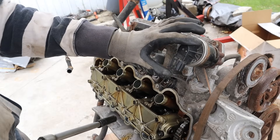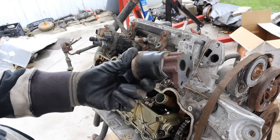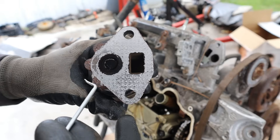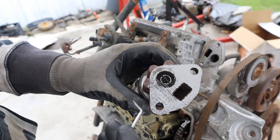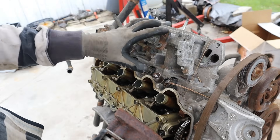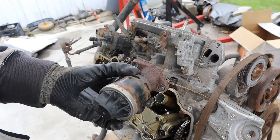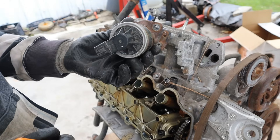Over on this side we have the very familiar Honda style EGR, reached by a 12mm socket. These EGRs are always known to cause problems in older Hondas because it has to control a lot of hot exhaust gases - they come back from the exhaust side and get re-burned into the intake for emissions, more so for this being a hybrid. Make sure you check the link above on how to service this and how it works.